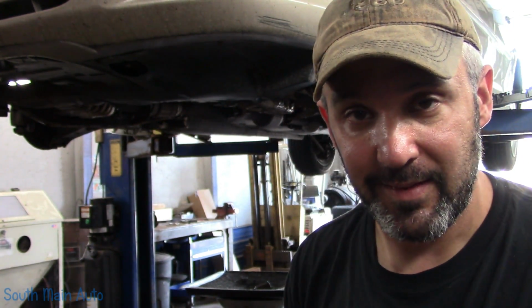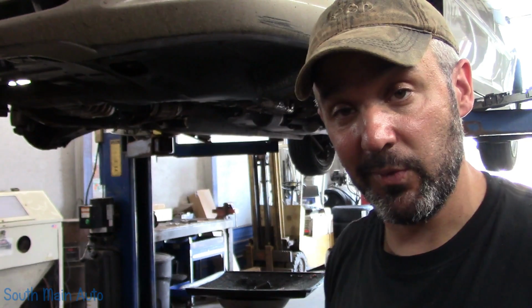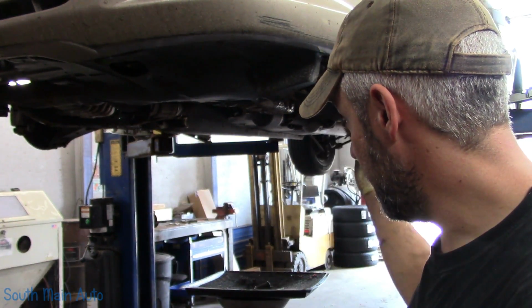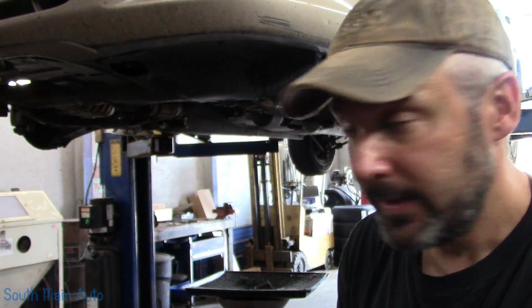So hopefully, like I say, you found the video helpful in some way to know that, if you have, let's say, I've done some cars where those lines are just discontinued, some Mitsubishis and stuff I worked on, they just don't make it. So we'll just take some 3/8 line, take the bender, little flares, tweak it, twist it, bolt it back where it was, and Bob's your uncle.